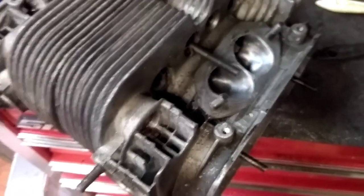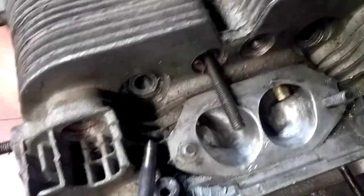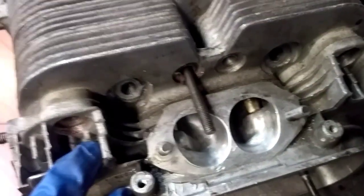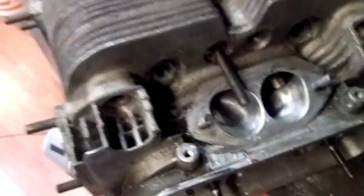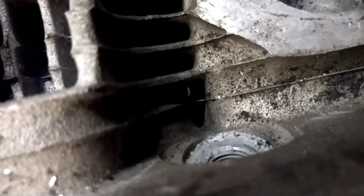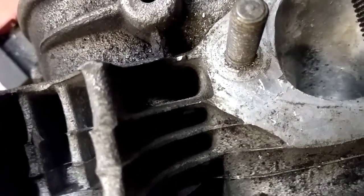The next area that you have problems with is these little square holes and pockets in here. On a factory Volkswagen head, these are all pretty much open to let airflow pass through — the valve guide boss sits out like an island and the air passes over it. But when they do these aftermarket heads, some performance heads like this, they try to cast everything thicker and beefier but they plug off all those holes. Some of it is just cheap casting. You can see on this side there's one hole open here, almost one there.